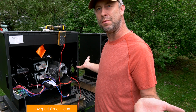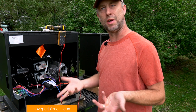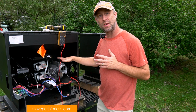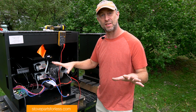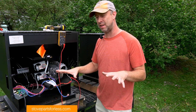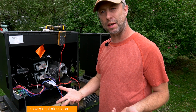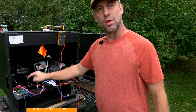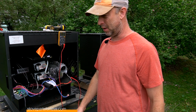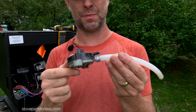I don't recommend doing this to run the stove normally. Don't run the stove by defeating that switch — that switch is meant to shut the power off as a safety feature so that you don't burn your house down. You can put that jumper on as a way of troubleshooting or if you're waiting for parts, but don't leave the stove unattended with that jumper on. This is a safety thing and you can cause a really big problem.